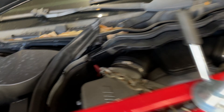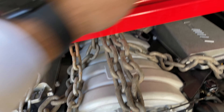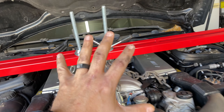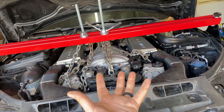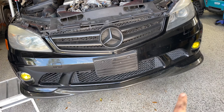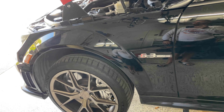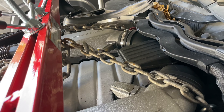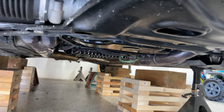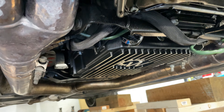So here's how I currently have it set up: I have the middle of a chain going to the front, looped on each of the bunny ears on the support bar. Then I've got one big chain at the back — one end goes to the rear, brought to the center, and the other end goes to the other side. I took up all the slack and tightened these as much as I could, so this engine is now being supported by this bar, along with the subframe's two motor mounts and the transmission. Now I'm going to take off the belly pans — eight millimeter bolts, plus a few zip ties — drain the oil, then remove the wheels and all the front suspension. It's going to be a multi-faceted project.